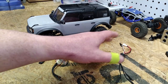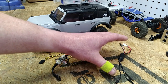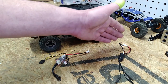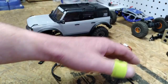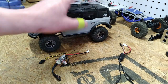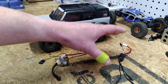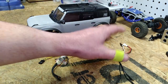The first thing I noticed with the Dinky RC speed control mounted in the truck is just how smooth and linear the throttle feel was straight out of the package. There's no perceivable jump out of the vector or FOC end of the throttle into the conventional brushless mode — it was just completely seamless. That transition is just non-existent, at least in this setup anyway. Your mileage might vary depending on the motor and gearing reduction in your truck, but for this setup the speed control just felt perfect at the throttle trigger straight out of the box.